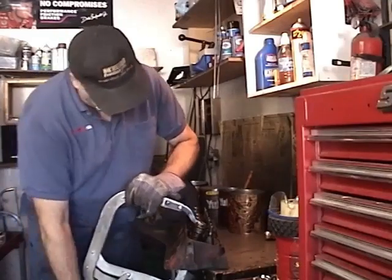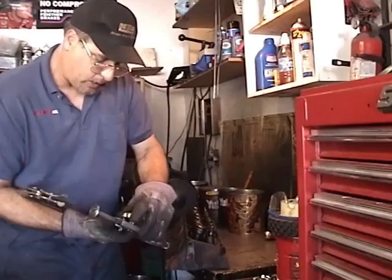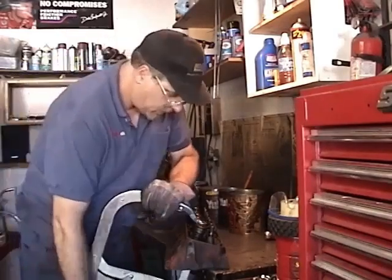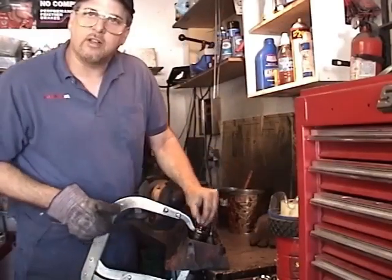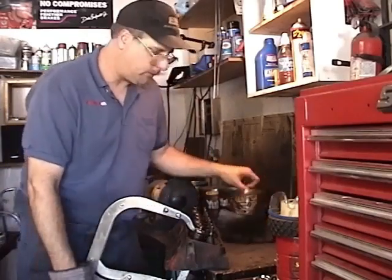So we'll put our spring compressor on here. Have to loosen it one notch. Okay. Start on the end. You're going to take your little valve keepers off. Throw those in the coffee can here.